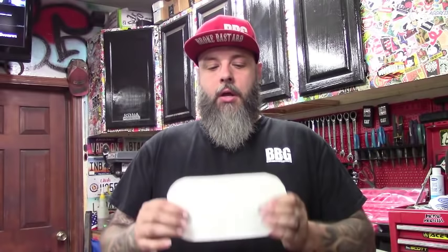The last couple weeks I've been staring at this dash. We got it all mounted, all riveted out, it looks good, but I can't figure out how I want to put the gauges on. A lot of you had opinions about using Apollo gauges and things like that, but I've weighed my options. I'm going to use what I've got — the gauges that came out of the build. I want the gauges to sink in rather than protrude. I've made a template for the speedo and tach to French them into the dash. The tricky part is making it look good and getting it flush.